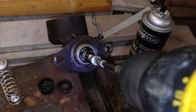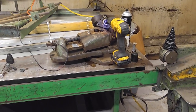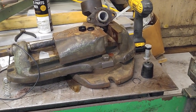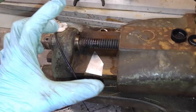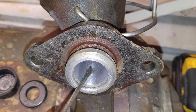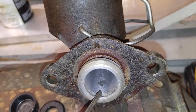These brakes were working — it was just leaking into the interior. Get those crosshatch marks! I'm going to tinker around with this thing. I've been honing this and I've got a spot of rust, but I don't think it matters because all the action happens further up. This is just a seal to keep the fluid from running backwards past this dust cup into the vehicle.